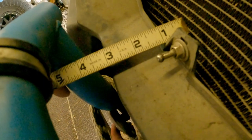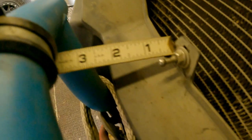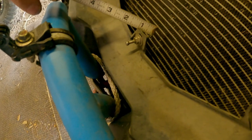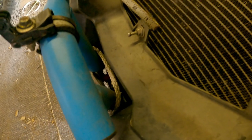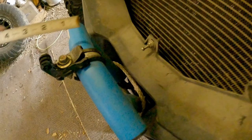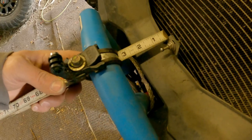Once that's done, back over here — take a quick measure. Inch and a half overall. That's about three quarters of an inch. That's a half inch. I would suggest leaving this stud as long as you can without hitting that radiator, get it to work, and then cut it shorter. I got about a quarter inch behind that nut. So it's: nut, washer, washer, nut. Just make sure your button is functioning correctly. That was my minimum — a half inch there, three quarters from the base.